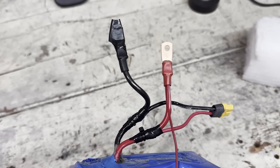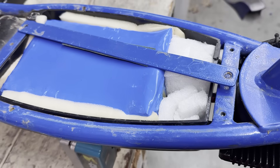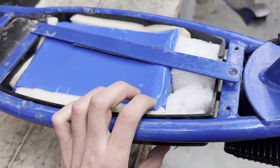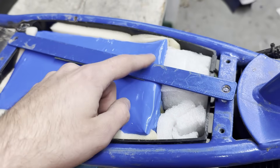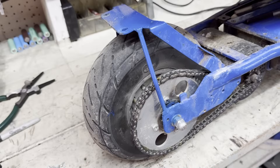I decided to skip the connector and go straight to the terminals since the wires are so short. Looks like I got lucky with the fitment. The only thing that could be too tall is the BMS, but the balance wires leave a perfect gap in the middle for it. Once I installed the battery and the controller, the scooter was ready to ride. But there's one more thing I wanted to change — because I kept standing on the back fender, this piece got bent down, so I put in a reinforcement piece.